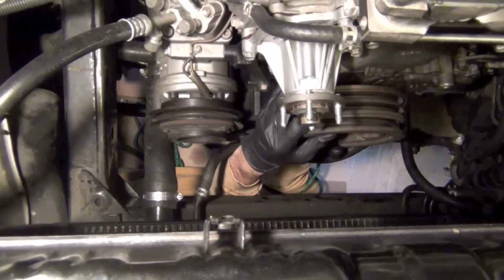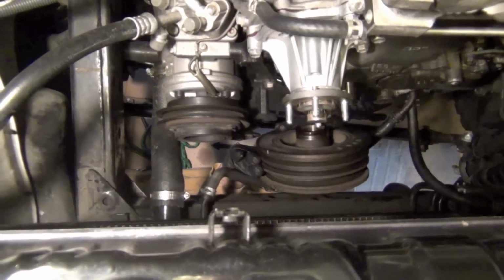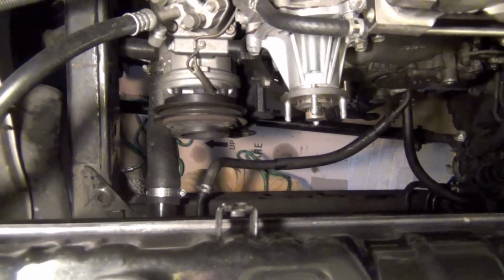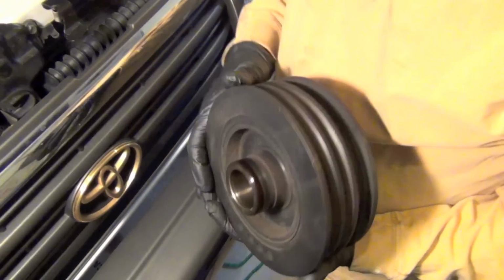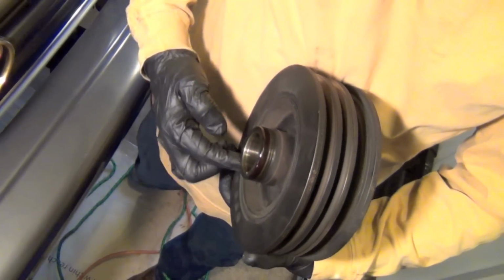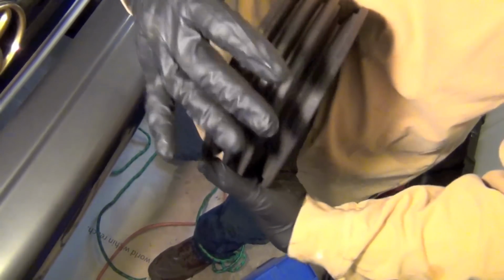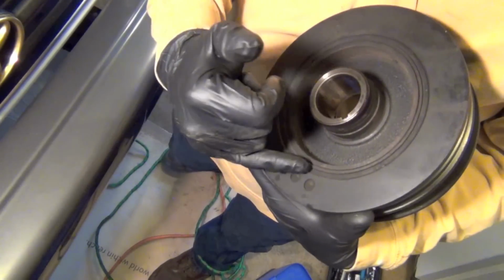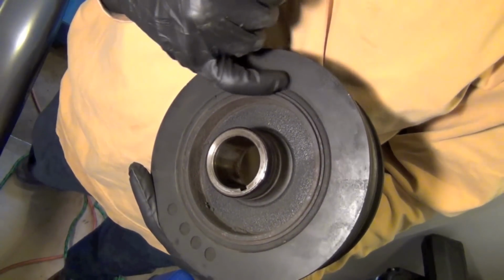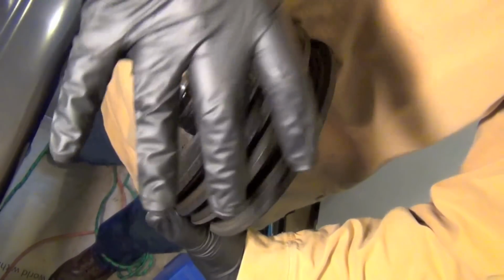And this is gonna slide right off. See, watch this harmonic balancer pulley and all. See, it just comes right off. And we'll take a look at that, and you see this little area right here is right where that seal has been sealing on the outside of this harmonic balancer and pulleys, obviously. But do you see right here, this is when they're talking online, there's a rubber separator right here that basically separates this pulley mechanism with all of this weight.